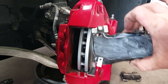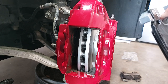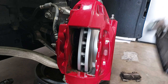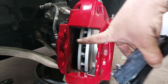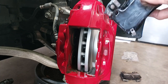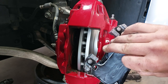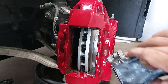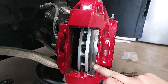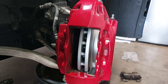You can see I've got a little brake lubricant just on the backing plate. You'll notice these little squeal tabs — those are the wear indicators that contact the rotor surface and squeal to let you know the pads are getting low. On this car they were on the outside of the caliper, facing down toward the back of the car. I confirmed the correct orientation from the other side I already did. Also notice there's an R and an L marked on these pads — right and left. If both pads facing the same direction show the same letter, you've probably installed the wrong pair together.